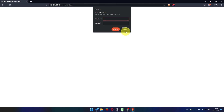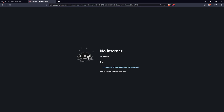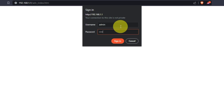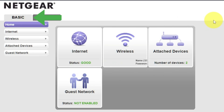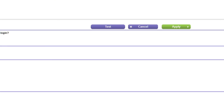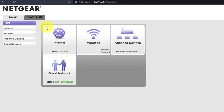After the reboot, wait a couple of minutes and try to Google something. If it fails, check all the cables — they must be connected correctly. Then log into the router control panel again. Go to Basic, then Internet. Choose "Use computer MAC address" and click the Apply button. Then reboot the router again.